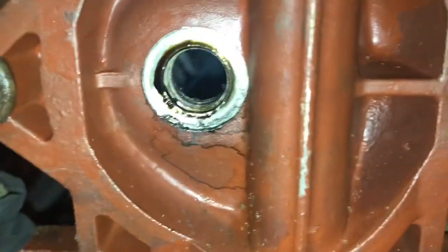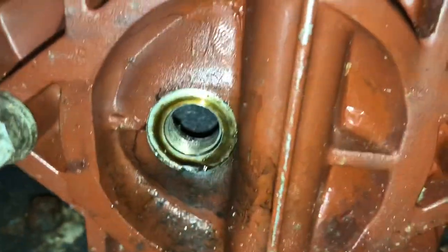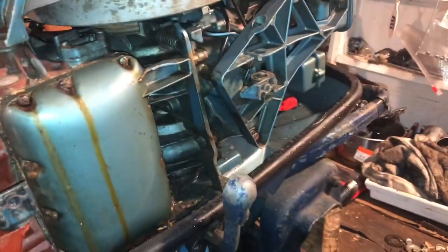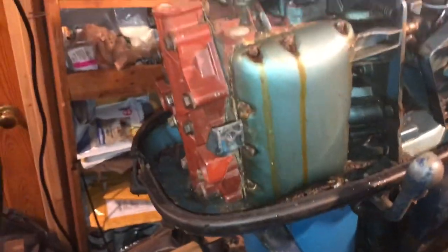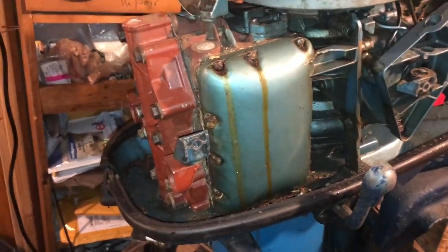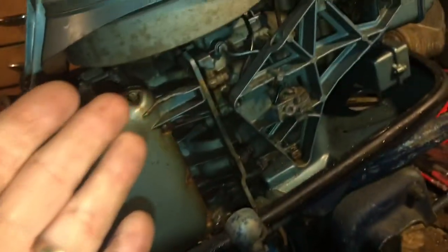So we're going to run right to the fuel section — we'll clean the carb and see what we're working with. The inside of the cylinders looks okay; a lot of carbon built up on top of the pistons, but we can always throw some Sea Foam in and fix that. So we're going to check compression and then clean the carburetor. Since we already have spark, once we've got good compression and good wires, we're set.